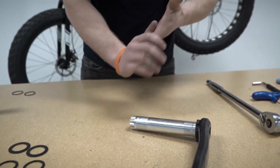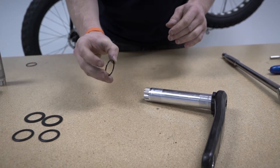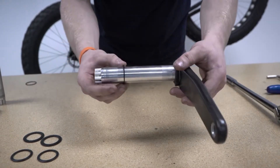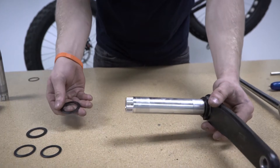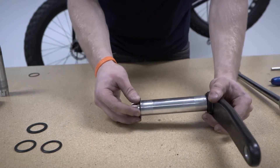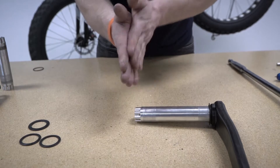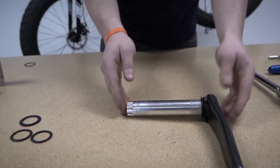The next step is to install any spacers that need to go on the non-drive side for your new crank setup. Check online at Raceface.com for the correct spacer setup for your chosen bike. In this case we're installing one spacer, then we take the dust caps that come with the BB on the bike you're installing the crank to and put those on. Note that some dust caps are different sizes, so make sure you use the ones for the BB you're fitting. That's the non-drive setup ready to go.